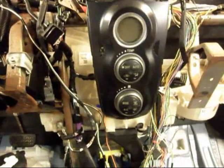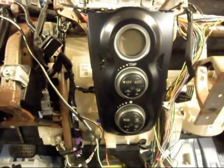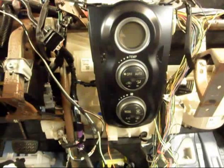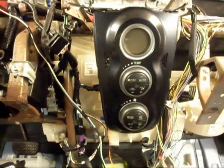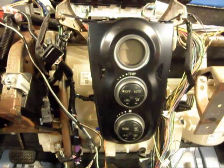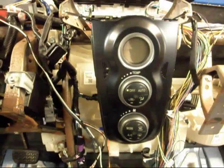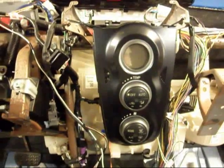The other big piece is the blower. If we look at the bottom of the blower assembly, there is a box attached to the bottom in place of the blower resistor assembly. The speed control on a USDM one is done by switching in various resistor values, whereas in the Japanese one there is a digital control built into the bottom of the fan assembly. That was one piece we missed in the import, so I actually created a MOSFET-driven speed controller that takes the signal out of the AC ECU and adjusts the speed of the fan relative to that.